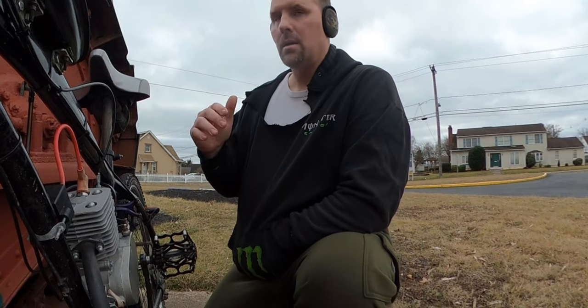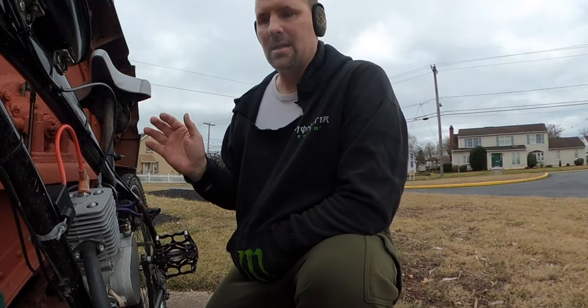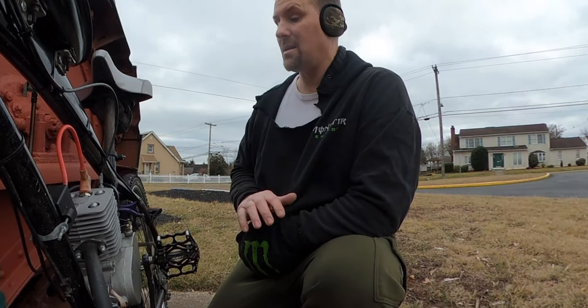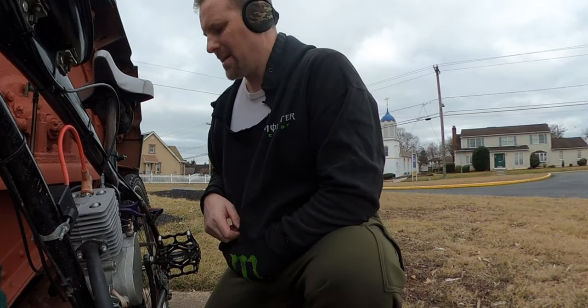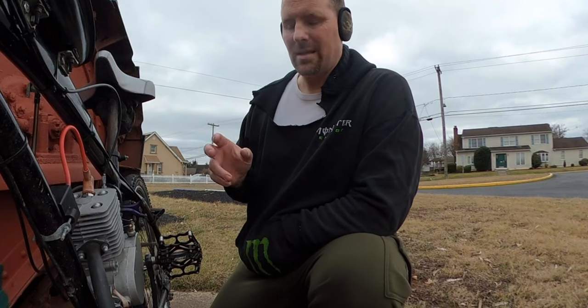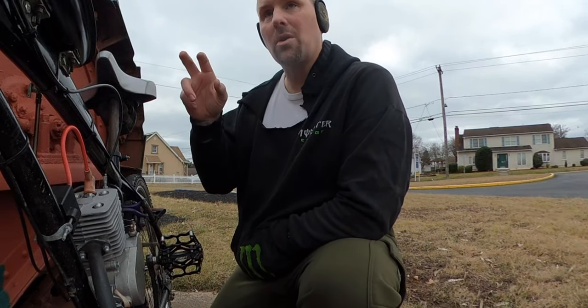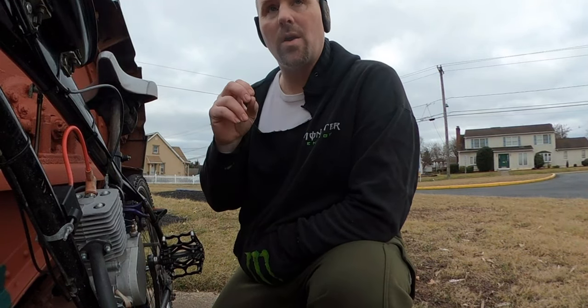It will run, it will be whisper quiet, and it pulls, but it's not exciting. It doesn't pull hard. It doesn't have the power that he's looking for in my eyes. It definitely has more than a stock motor, but not like he's really expecting, I think. So I took the cap off to represent a gutted pipe. It's not the same because you lose a lot of back pressure. So you hear how it was four-stroking when I try to get on it in the higher speeds. That's because, you know, back pressure, it's running really fat.